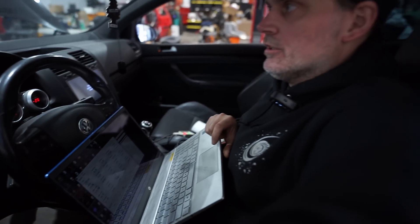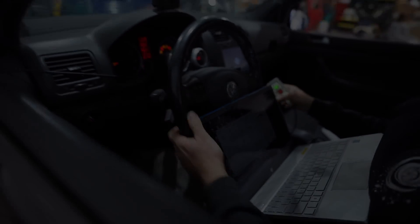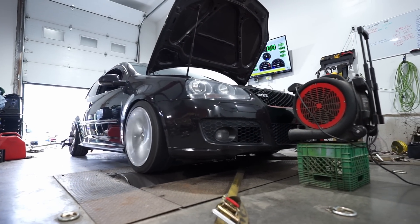This is the first time we're turning the boost up. With no boost adjustments at all — just playing with timing — we started at around 323 or 327 and on the last run at the same boost we did 391. That's solid proof that the water meth and timing together are working. The timing is basically at the limits of what I want to run right now, so now we're going to turn the boost up a little bit and hopefully make a difference.